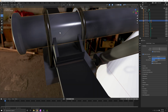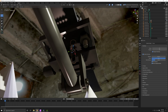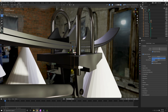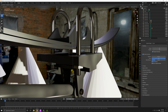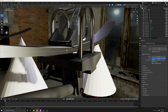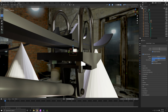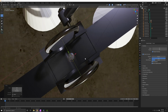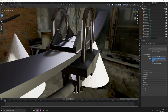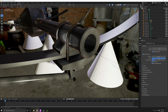So if I were to hide this guy right here, that bolt has to be tight to these leaves, which is not in my 3D, but it has to be tight right here. Has to pull both of these together, right? Let me just get this so it looks a little better. There we go. It has to pull both of those together, and it has to go right into that centering mechanism of the perch on your differential. Got that? That is very, very important.